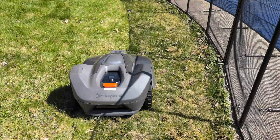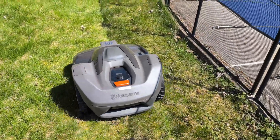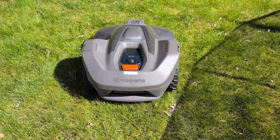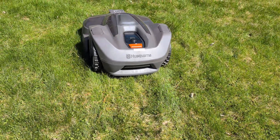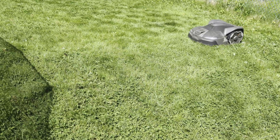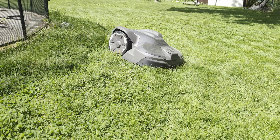There are a few interesting things I learned about the automower. When mowing, it mows the perimeter before doing the rest of the working area. If you stop it mid-session, the next time you start it, it goes back to where it stopped and finishes. For a cutting pattern change to take effect, the previous cutting mission must be completed — you can bypass this by making a slight map change, like moving a waypoint, then starting a new mission. Once a work area is cut, the automower won't return to it until the next scheduled day. The triangle pattern has three missions, checkerboard has two, and parallel has one — a single mission fully cuts the grass.